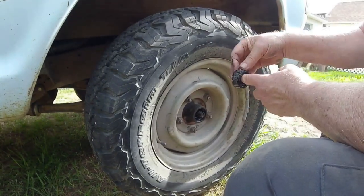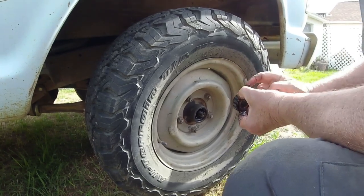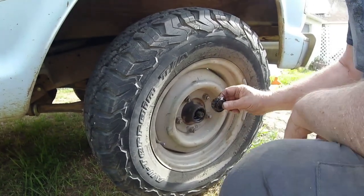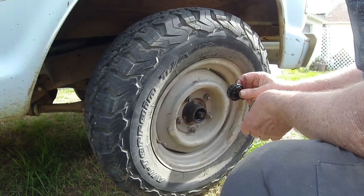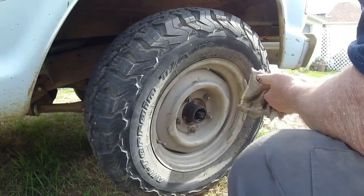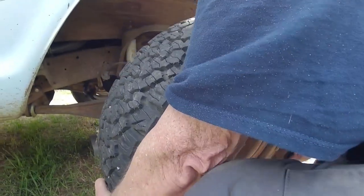This bearing I just dropped in the dirt is a cone bearing — you can see how this diameter is smaller than this diameter. The bearing on the other side of the hub faces the other way, and both of these bearings sit in tapered races. As the bearings are pushed towards each other with that nut, it removes the wheel bearing play. That's old school technology — these tapered bearings were used on a lot of rear-wheel drive vehicles years ago.